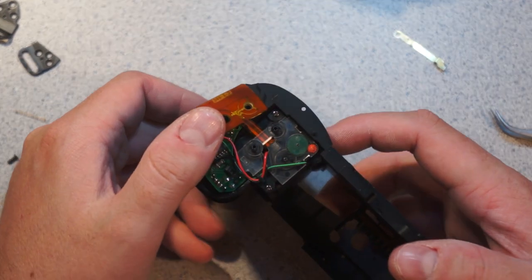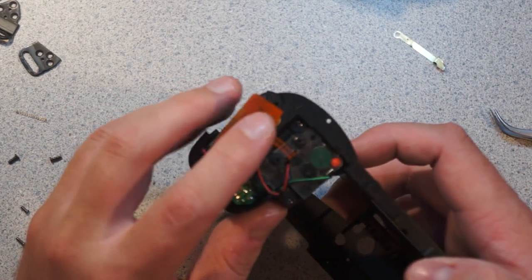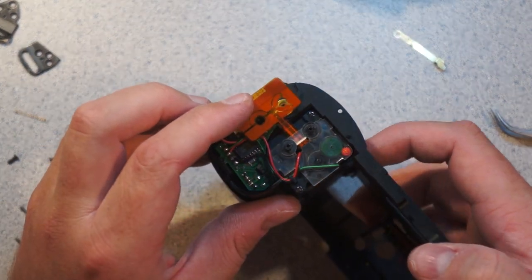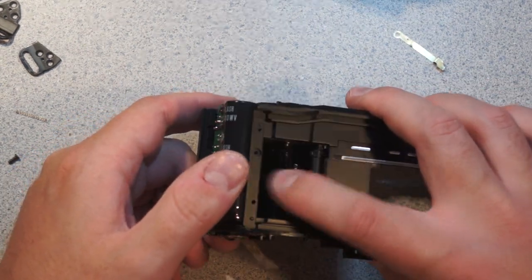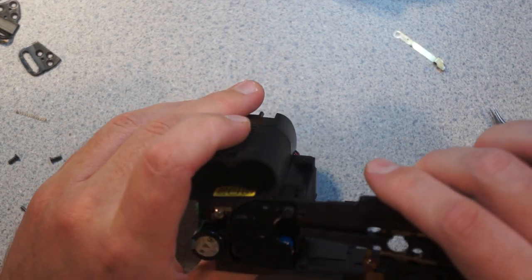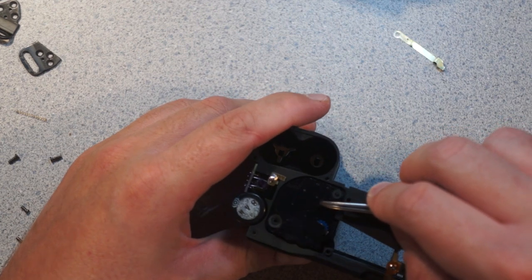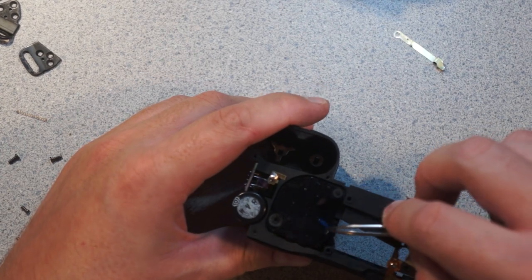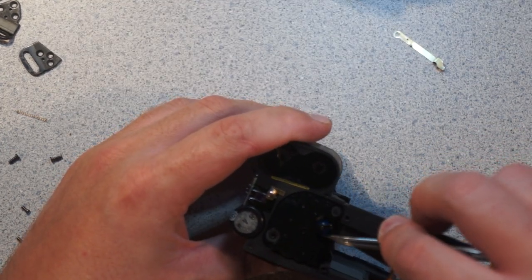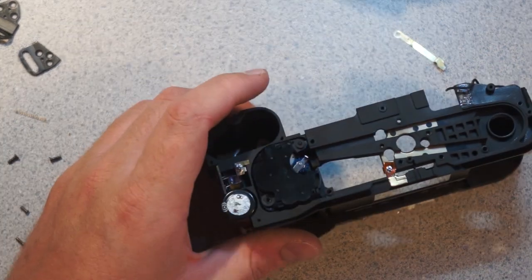Oh, I see. Okay, so there's two separate things here. You can see that this little gear chain up here is driven by these little film sprockets. That feeds into what looks like this Hall effect sensor here. Whereas down here, I think the motor may actually be in the middle of this reel, which is kind of a clever way of packaging it. Oh, no, wait, this is driven, sorry. One of these gears is some sort of clutch assembly. Oh, there we are. Look, they have some funky clutch shenanigans going on here. I do love their excessively complex mechanical things, don't they?